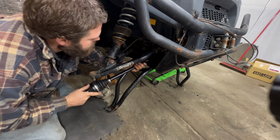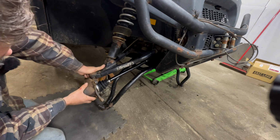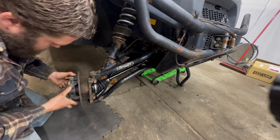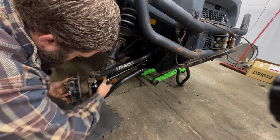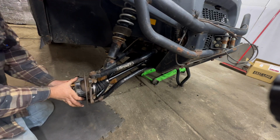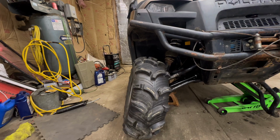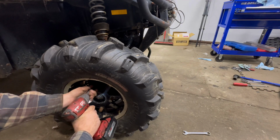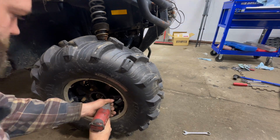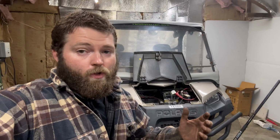And then, nice. Go ahead and put our bearing knuckle assembly on here. The upper ball joint was nice and tight on this. The lower one was shot though. Now install the hub. Beautiful. Well, we're getting closer. I gotta jack this up a little bit. Alright. These on. And we still gotta torque down our hub nut here. Lower the jack down a little bit. There. Well, we're getting there now. We just gotta do the other side.